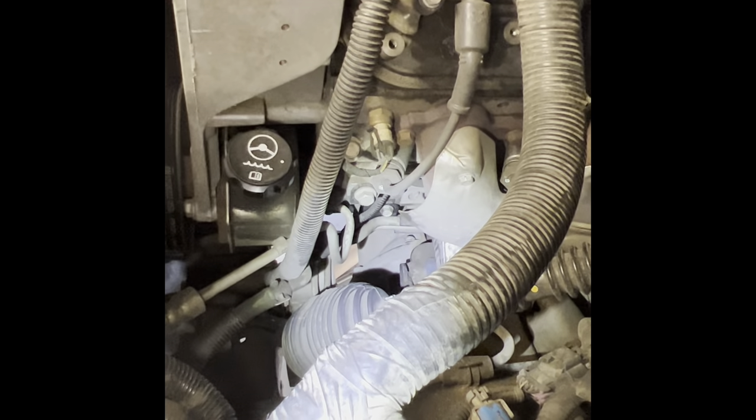There we go, that's going to work. Can you see it? There it is. I'm doing this one-handed here folks, trying to get you to see what I'm talking about - right there in that little hole. It's going to take a long extension. They say it's a 14 millimeter at the dealership, so that's the one I want to go after first. Loosen it before I take off those two 10 millimeter bolts, then loosen it enough to get the gasket out, clean it, put the new gasket on, and tighten it down to about 22 foot pounds.